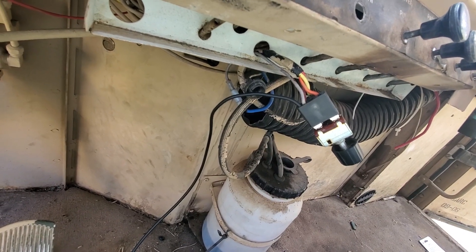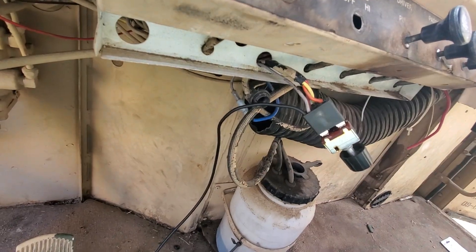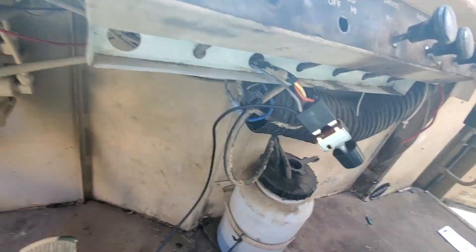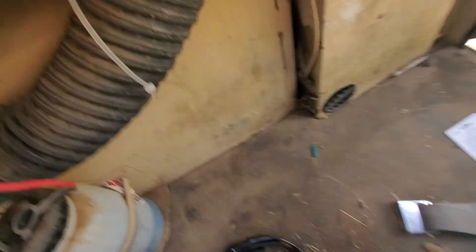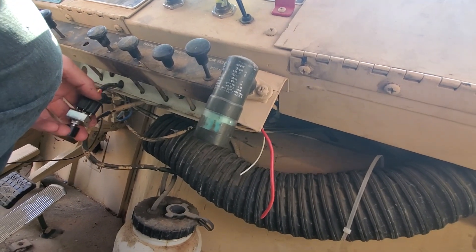What you can do if you don't want to splice into the wires is just jump into that wire and put an inline fuse in — 30 amp will be just fine — or put a breaker in, whatever you want to do. Separate breakers are pretty good. If you put power to that switch and you have power coming out on each one of these terminals when you turn the appropriate switch setting...